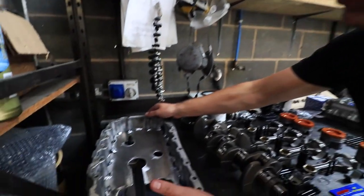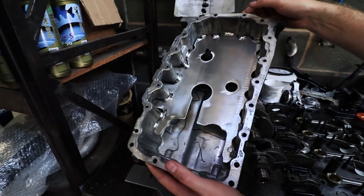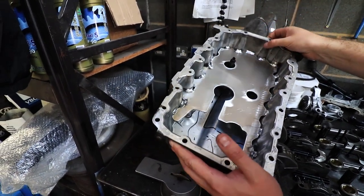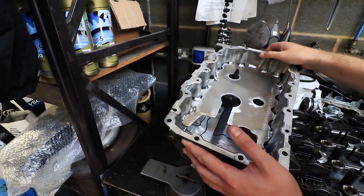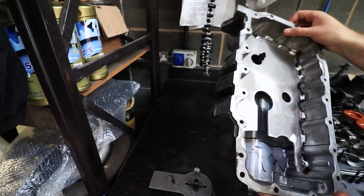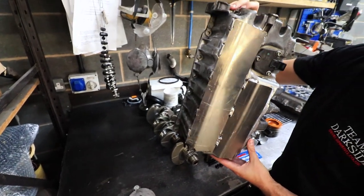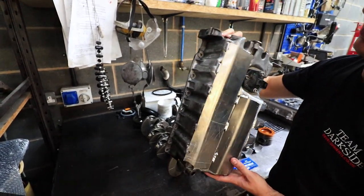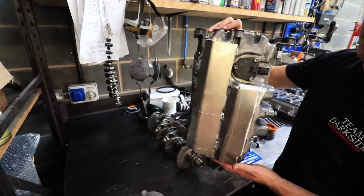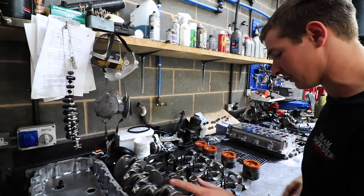The sump — because we're using the new style oil pump we've had to make this sump up for this car. We've cut this plate out and welded it in; doesn't need to be too pretty inside. We're going to have these laser cut for the next one. And because it's not the hybrid sump like we'd prefer to run, we've welded some aluminium up the bottom there — just so if you hit a kerb it's not going to bust it.